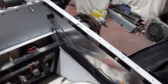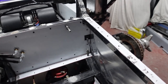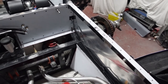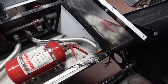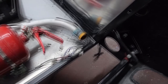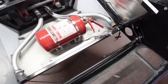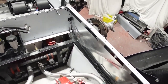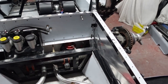I de-pinned the main ISO block and a few other smaller blocks that feed the radiator fan switch and the fans themselves, and passed them through a grommeted hole in the chassis. Those are going to run in the void between the inner and outer panels, and where they come through in the corner they'll be clipped to the chassis — feeding the fans and the radiator visibly kept to an absolute minimum, so you'll see no wiring loom.